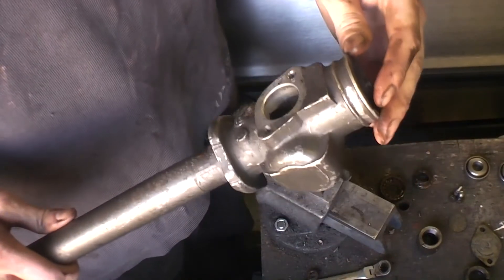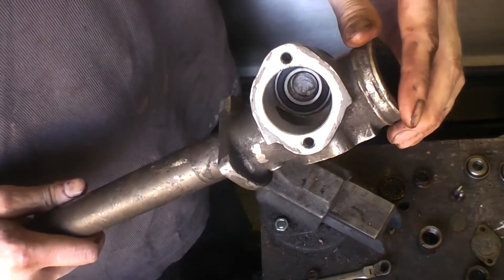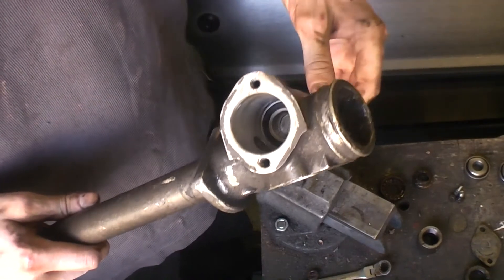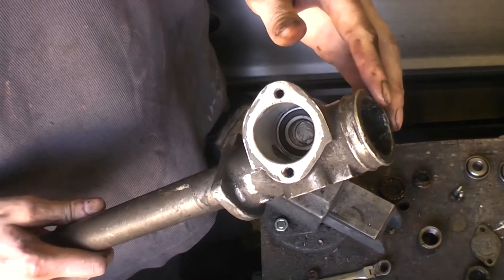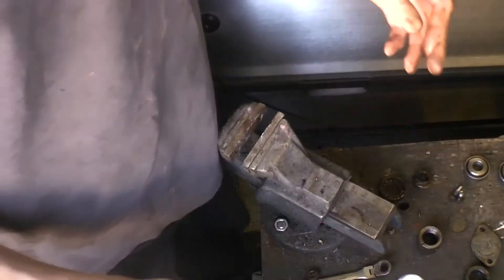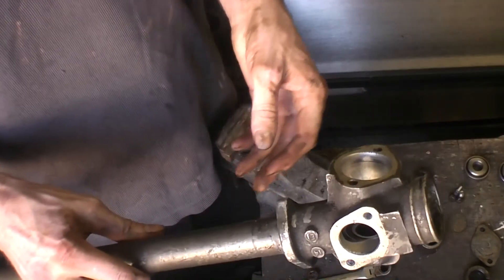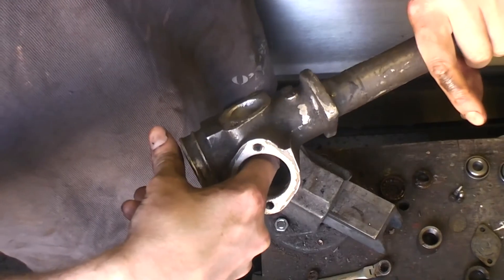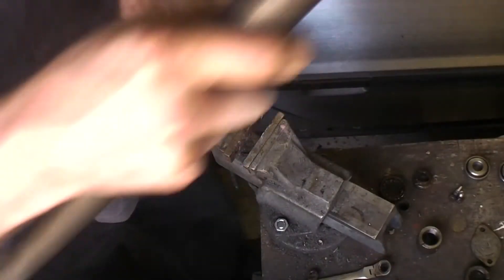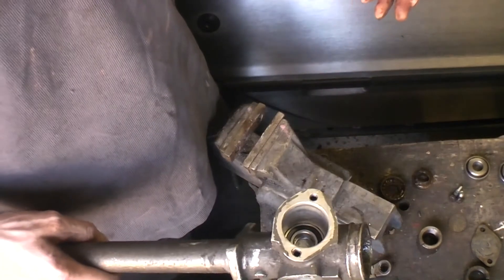I want to show you the disassembled pinion housing of a much better conditioned steering rack. This is one of the bearings. I've never liked these open bearings because the whole thing is basically designed to hold oil — but as soon as a steering rack boot fails, all the oil escapes. Those open bearings, which are under quite a lot of strain, lose their lubrication. The top one in particular loses its lubrication because it points upwards, so the oil pools at the bottom and the top one never gets any. The ideal solution would be to fit sealed bearings, but unfortunately nobody really does 45-degree combined axial and radial bearings.